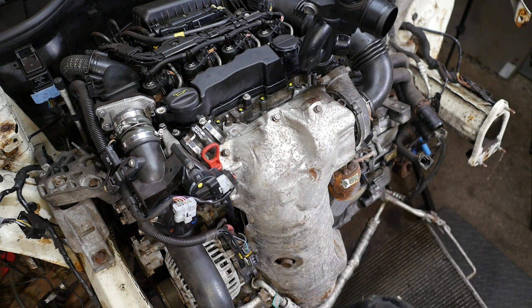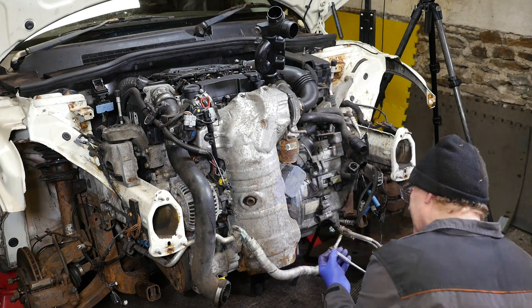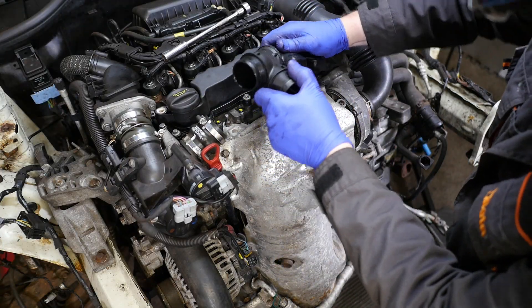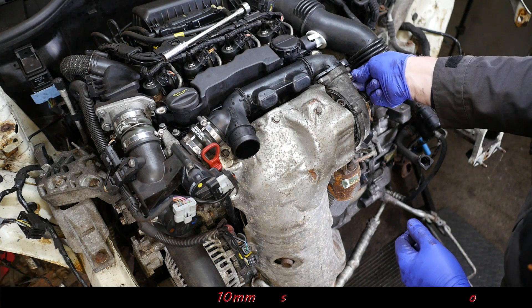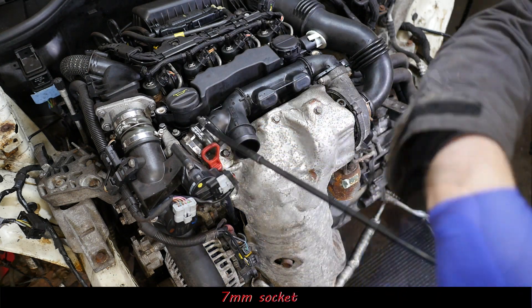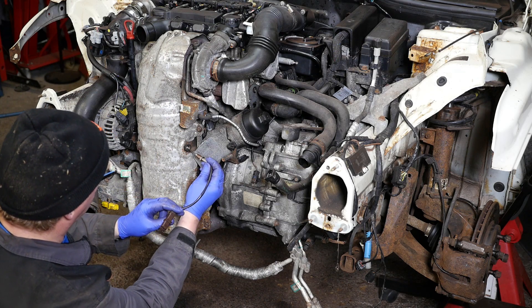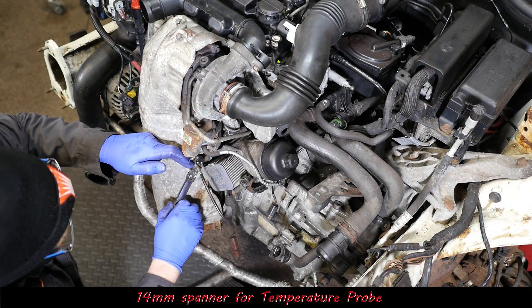There's quite a bit going on when you've got all this emission control equipment - it does add a fair bit of complexity to what would normally be quite simple. Now we can slide this interconnecting pipe in - that's a 10 millimeter socket there, gently tightened, then a 7 millimeter socket for the jubilee clip. Now on to the temperature sensor - put a little bit of copper grease on that to help it go in, then tighten with a 14 millimeter spanner to about 30 Newton meters.